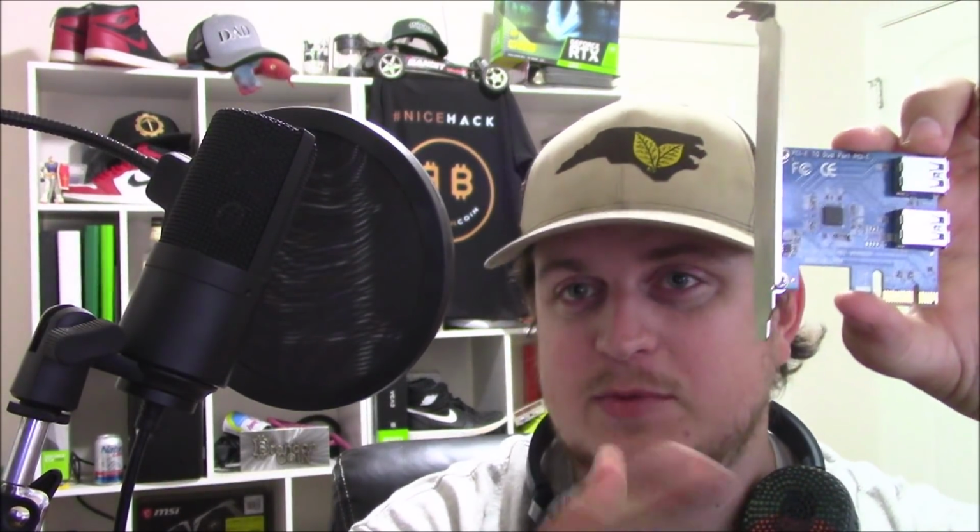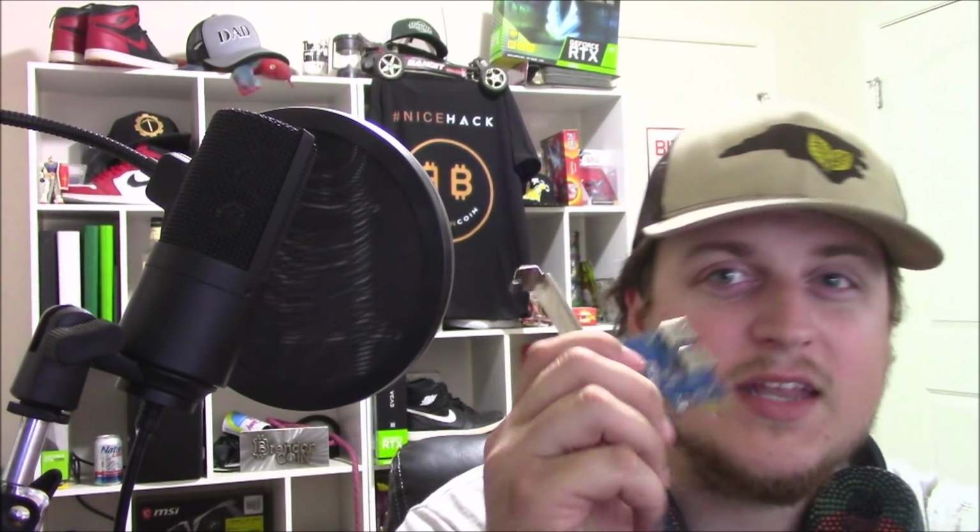But the main use that I like to use these PCIe splitters for is taking cheap computer setups like that Lenovo, for example, on my brother's. A $20-$30 computer that you can pick up off of Craigslist or Facebook Marketplace. You put that in, and then bam, you can run 4 graphics cards. You just need the external power, which you could get from something like a server power supply. So now you know how to get these things up and running.